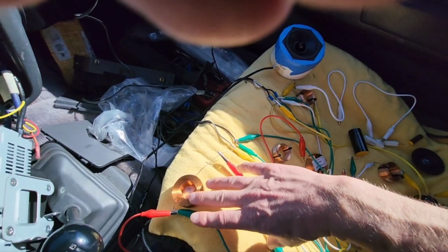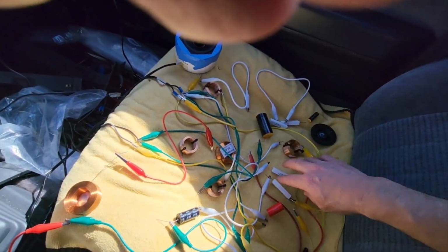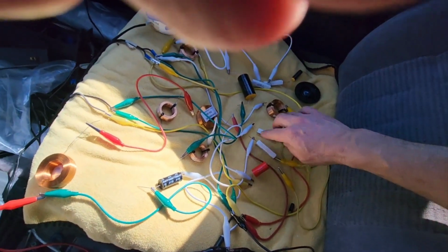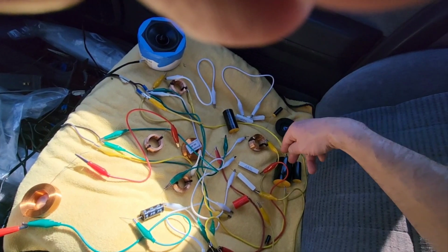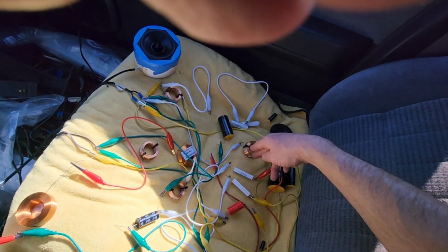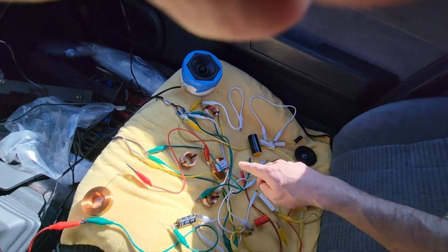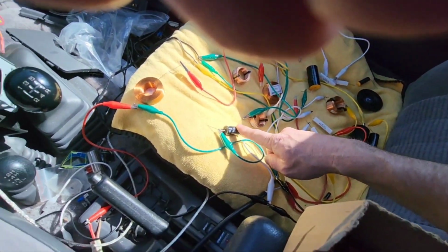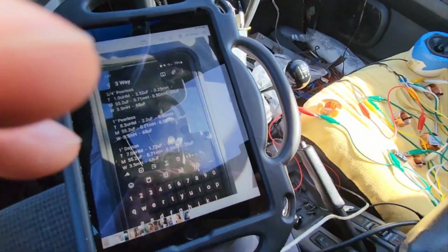So there's 2 components on the woofer. Let's go back. So there's 3 components on the tweeter: a resistor, I'll get 1 piece for that, a cap and an inductor. For the mid-range, there's a cap and an inductor, and then an inductor, then a cap. So 4 components, so 3, 4, and then 2, just an inductor and a capacitor. So it won't be too crazy. So 9 parts per side.